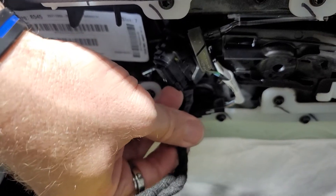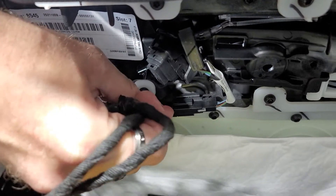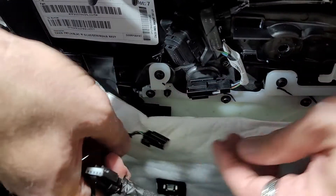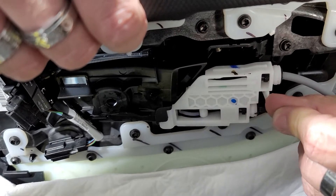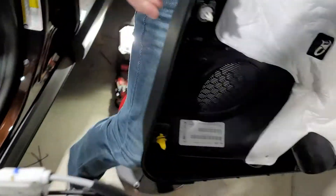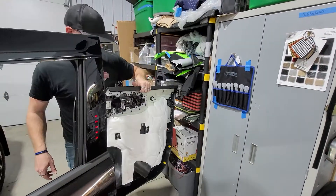You want to come around here. In here you have two plugs — one here and another one right here — and they're pretty easy to unplug. This bad boy right here: you click right here — see that? Click right here and this whole thing will come out like so. Don't do it any other way. And then the back of the door panel looks like this. And that's pretty much how you get these.